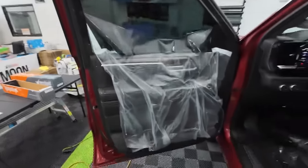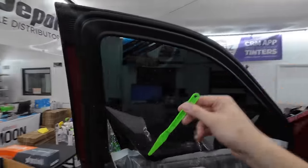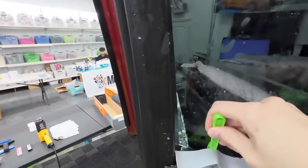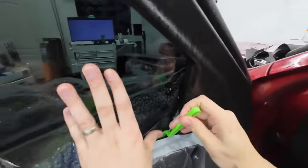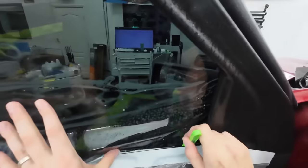Windows rolled up, we're going to peel out the liner, spritz that glue — and then to tuck it in, I need my last tool for the install: the shank, this funny butter knife. We're going to pry back that seal, start at one corner. What I like about this butter knife is it stays out of your way and gives you a little more space to work with.